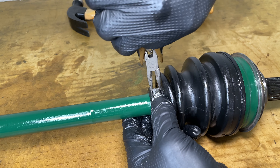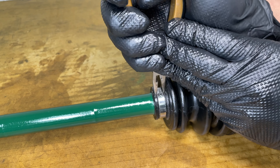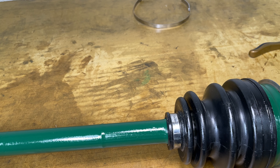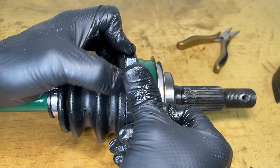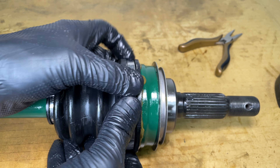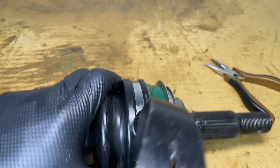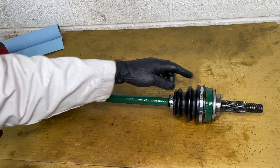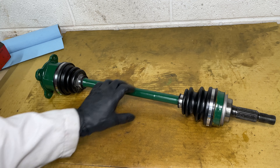Next is the bigger small clamp. Latch the little piece, then close it. Squeeze the tabs together, then hammer them down. Squeeze the tabs again, hammer again. The outer CV joint gets the smaller boot clamps. Pull the rubber boot back to make more room for the hammer. I'm hammering around the band to make sure the latch sits flat with the rest of the clamp. These outer ones take more force to close because extra grease is getting pushed out from between the rubber and metal. It goes pliers, hammer, pliers, hammer — then I know for sure it's tight. That's it. These are done. I have all four clamps on here. This CV axle is ready — just wipe up the extra grease.